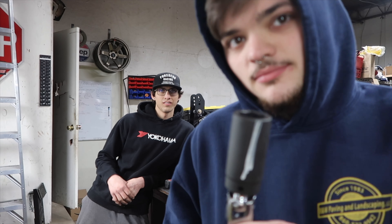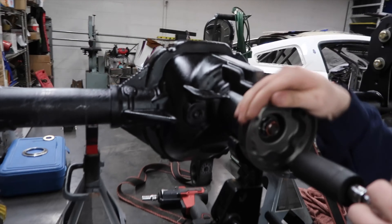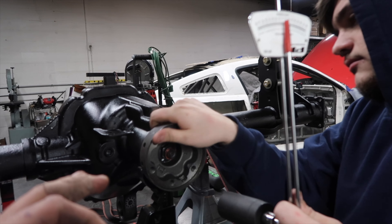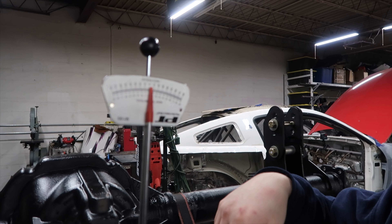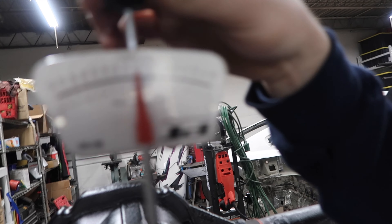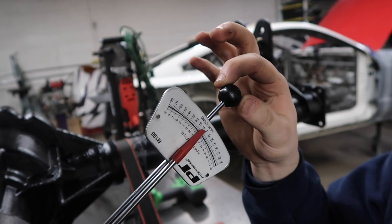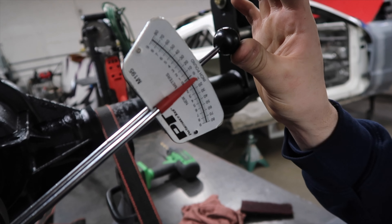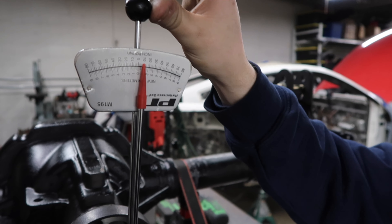We checked the play - now we're going to check it and see how much turning torque we've got. Hopefully it's not over. Special tip: put a line on your sockets so you can see the socket move. Many many small turns later we've made a little bit of progress - we're at about nine to ten inch-pounds of turning torque right now. If you've never seen one of these inch-pound torque wrenches, as you put torque on it, the needle bends and points to the number you're at. But you don't want the starting turn torque - you want the as-you're-turning torque.